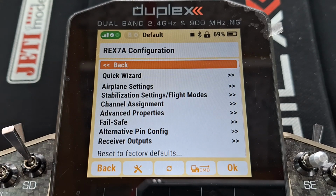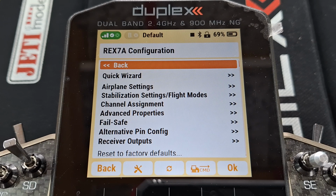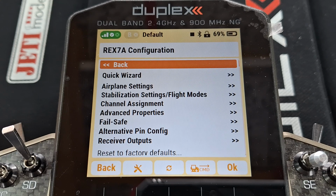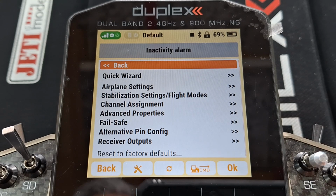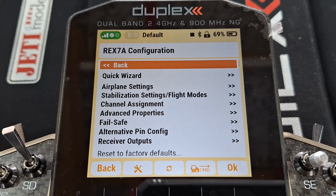Well, that's fine, but we need to have the 3 modes available then: normal damping and heading hold with the nose leg stabilization switched off, and a normal damping mode with the nose leg stabilization switched on. So that's the 3 assist modes taken up. So we need to get rid of the off setting in the modes, and we do that by choosing a different switch on my transmitter.